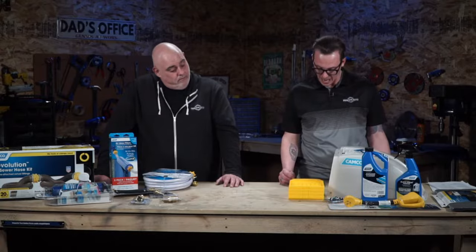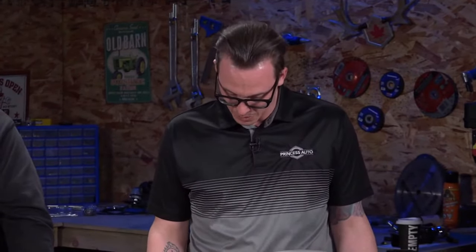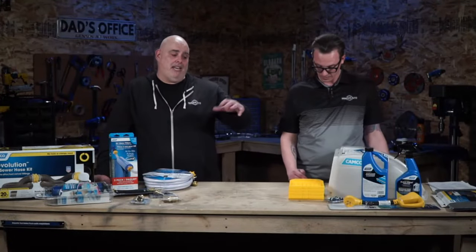We got another one here. Can the home plug adapter be used with a battery tender over winter so as not to remove the batteries from the RV? You could, as long as the connections are kept as waterproof as possible. I wouldn't want the cord to be laying in the snow in case there was some melting. But that's really one of the applications, to keep that tender topping the battery up. Although if it's very, very cold out, the output from the battery tender may not keep up with the demand to keep the battery as warm as possible, and the battery could still freeze. Yeah, for sure.